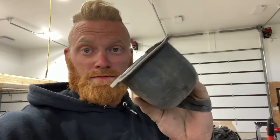Okay, so I think I figured out how to do this. This is the second day — it was getting too late. I've been trying a whole bunch of different arrangements with the stock intake. I tried to feed it under the inside of the wheel well, from the engine bay into the wheel well, just so I didn't have to mess with any of the stock stuff and try to make it as stock as possible. That's not gonna happen. So what I did was I actually took out the bottom of the air box, took the piece like this, and I cut that off — I just grinded that out so I could get full coverage on it.